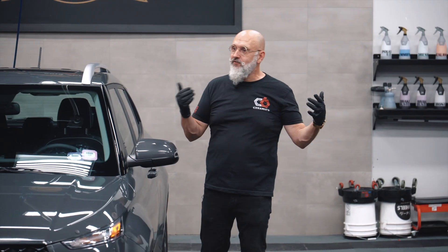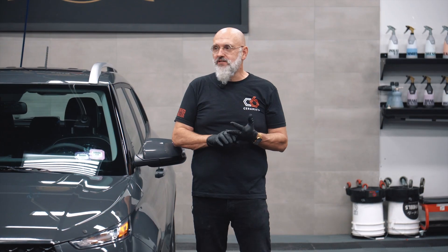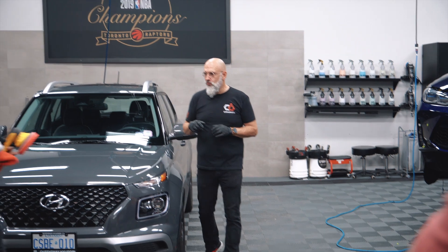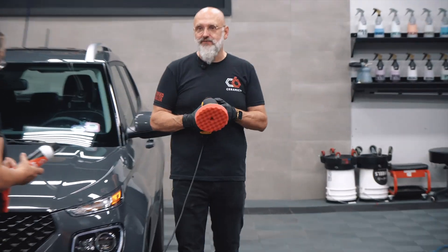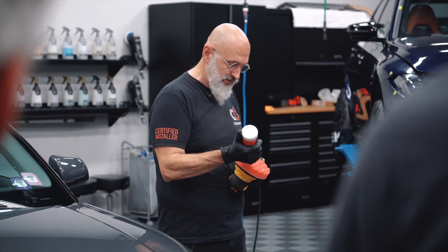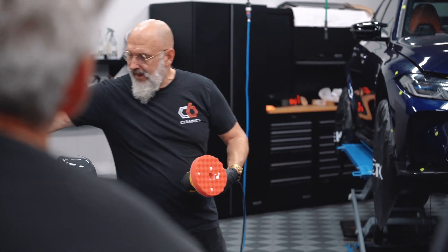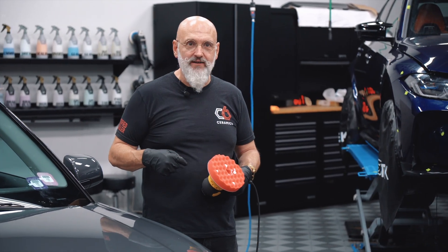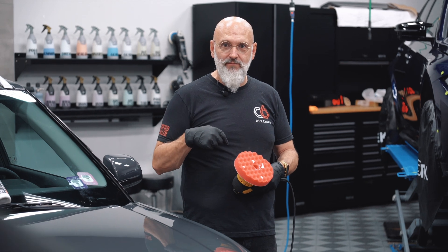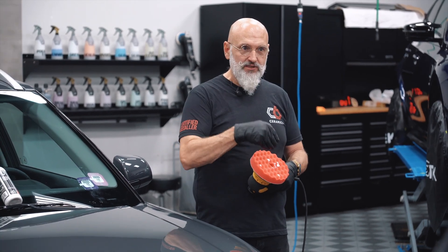The adhesion promoter polish — for those of you that want to try it, I'll start on the hood and we can go around as a team. Pay attention please. Those of you that have been following me, I've been telling you never use a dry pad, always clean your pad and wipe it off with a damp towel. Well, old dog learns new tricks. For the initial application, I'm putting four small drops, and you'll notice my drops aren't in a line on the outside of the pad. That's a mistake a lot of people make. If you're using a polish with drops, don't put them in the same concentric circle — you end up having just that one concentric circle doing the job. Space it out differently on the pad.